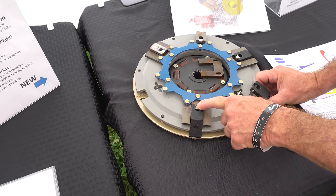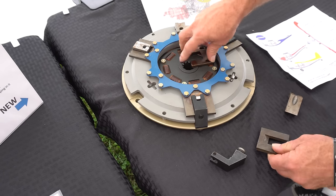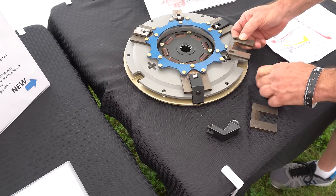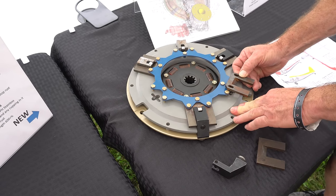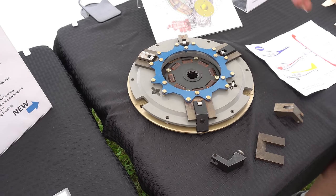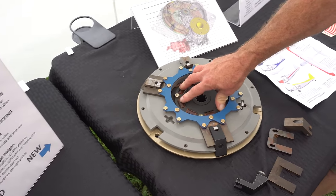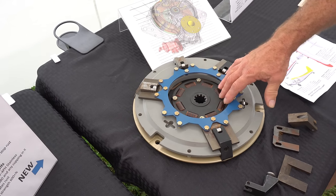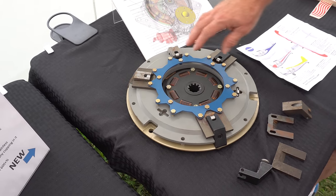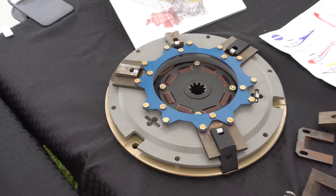So these are the weights — they've got roller bearings in them. The counterweight fits in a slot here. Centrifugal force brings the weights out and they get pinched between the plates, which puts pressure on the pressure plate and engages the clutch. It engages at 800 RPM. It's like a Hayes drag racing clutch — there's no slip, it's either in or out. This thing grabs at 800 RPM and stays engaged until you shut the engine off. We've also got polymer and springs — double dampening — which helps with the harmonics, just like it does with the transmission in your car.